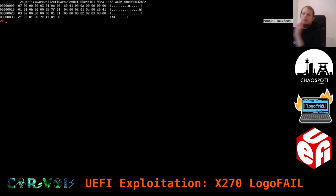Okay, so right, I remember something. Yesterday we looked at something in the flash that looked virtually similar to this. I recall the 02, 01, 0C, 00, D041, and so on. Let me quickly prepare something. There, right. Let me copy that D041 03 and so on. Do we find that in our firmware? Yes, we do. And that is actually in, oh, it says boot CD-ROM something. Interesting. Boot floppy something. I guess D041030A something has an extra meaning. Oh, well, I'm actually finding that a bunch of times.